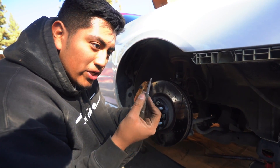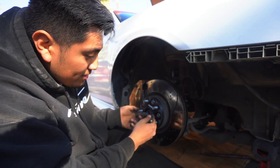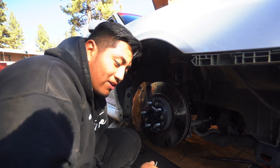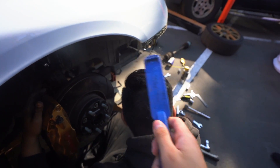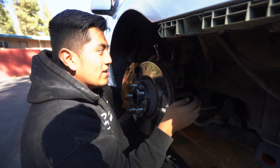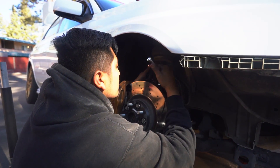In order to take off an axle nut you need a punch or something thin enough to get in between, because the axle nut is pressed inward so the wheel doesn't go flying out. So you punch it out — it's kind of hard to get out honestly. It's a 32 millimeter bolt holding everything together. We had to drop the hub and take it off from the struts of the airbag. Just disconnect the brake lines so you don't put any stress on those. Ongo's axles are a lot easier to pull out than on my car — on mine you have to push a pin out first, but once Ongo gets the hub disconnected he'll just pull on it and the axle should come out.